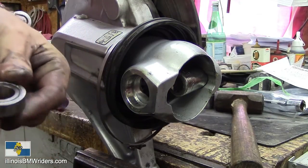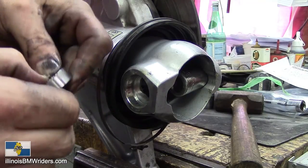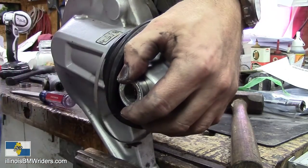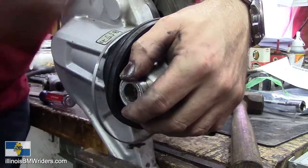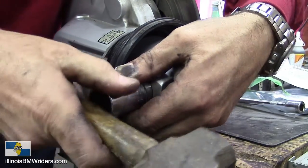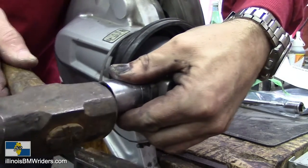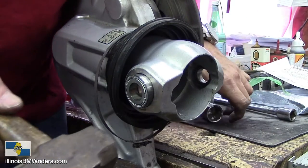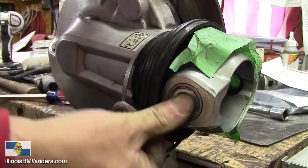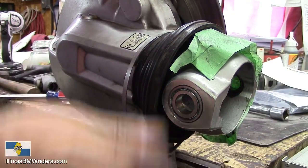Get the new one and pop this apart. Make sure we get it right the first time — the taper end points in. They look pretty much the same from this angle. You could put this in a vise and press this in; that would be a pretty good move. Back from the vise, it's all pressed in and good to go back on the bike. If you've got a big vise it's probably best to use that; if not, just make sure the backside is resting against something hard and tap it in. Anyway, thanks for watching.